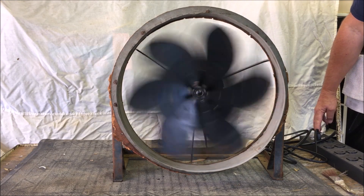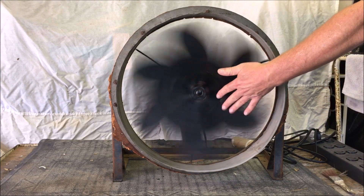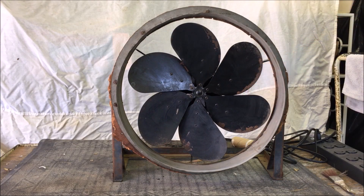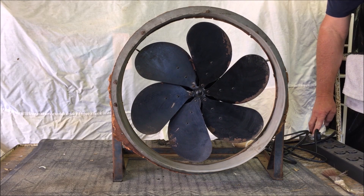You see that little hesitation in the blades. We're not really sure what that is — whether it's a dead spot in the stator or the rotor. I would think that an open in the stator would result in this fan not starting at all, but it does self-start in any position but the one that it's in.